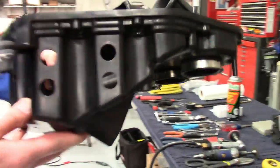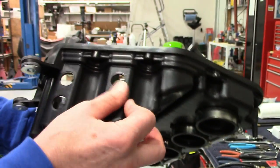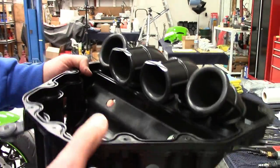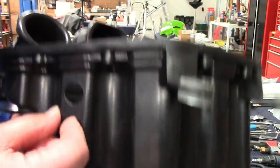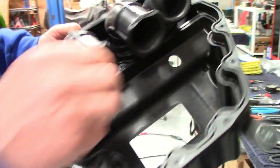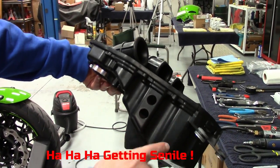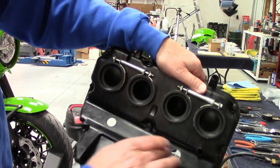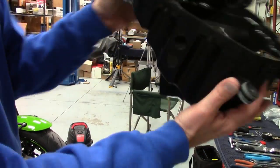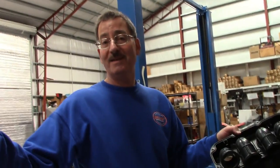Here's the finished product. No lip, inside's nice and clean. You don't even have to deburr it - this is a nice pliable plastic. With the step drill bit it's a lot cleaner than a hole saw. If there is anything, just deburr it in there with a little knife or a deburring tool. So you've got both sides - actually, still got to do these two and these two. That's the finished air box as far as the holes go. Next, we'll change the stacks.